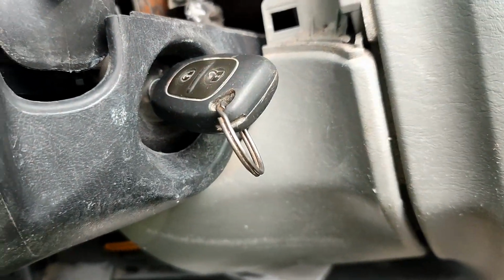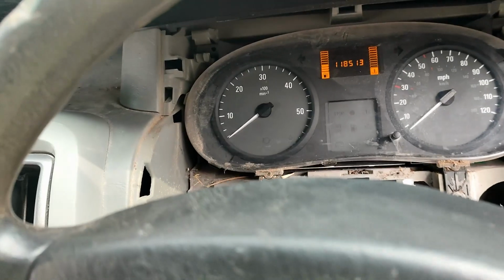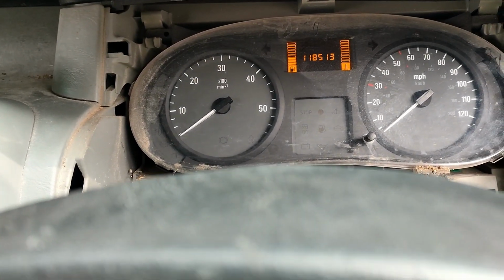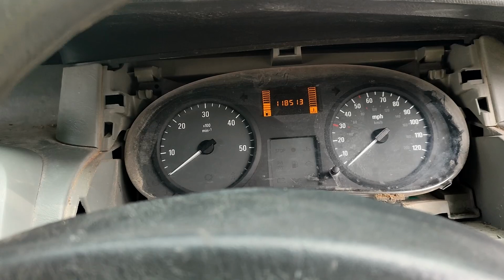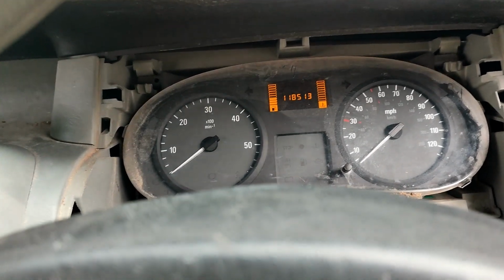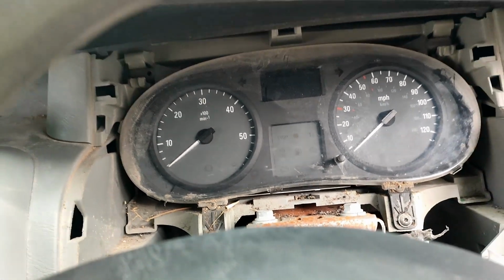This down here, you're going to have to take that out and get that replaced. Or it could be the wiring from that switch. Again, a bit of testing is going to be needed for that. If you're getting a lot of rapid clicking, like click, click, click, it's almost always a case of the battery being dead. And like we had then, with just one strong click, it's either the starter motor or a wiring issue. So let's go down and have a look at some wiring.